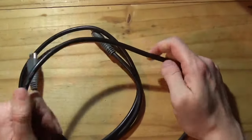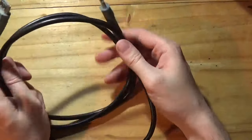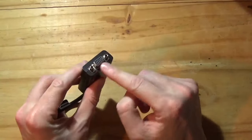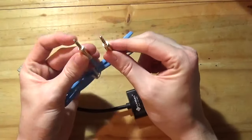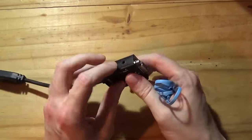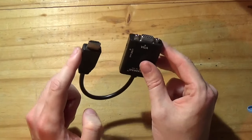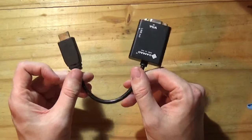Now let's look at video options for getting your C64 or VIC-20 to work wherever you are in the world. The C64 and VIC-20 both use a standard full-size HDMI male-to-male lead, which I believe comes with one in the box. There are alternatives you can try — I've tried VGA using an HDMI to VGA adapter. This particular adapter has an audio line out, which means you can plug in an analog stereo audio cable to a pair of speakers or headphones. I have to stress these are a little temperamental — it depends which monitors they work with and which output standards they support. Some of these won't work, and it's just potluck if you get the correct combination.